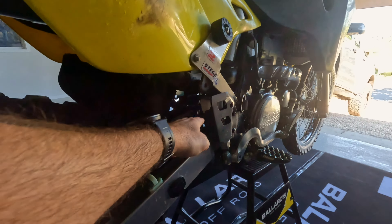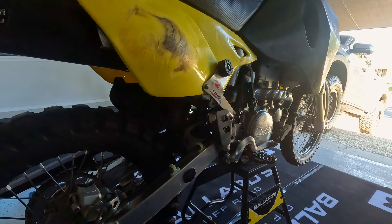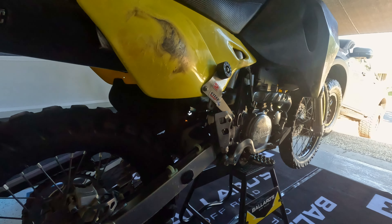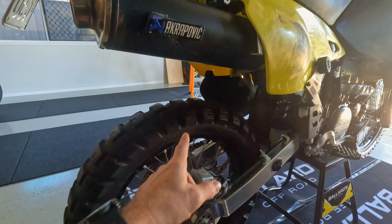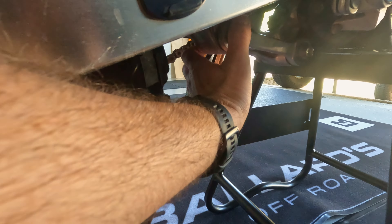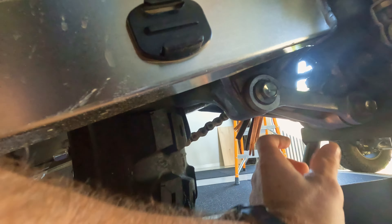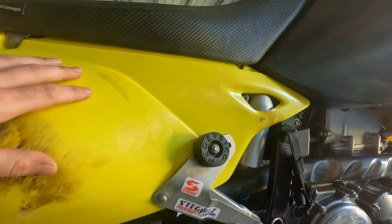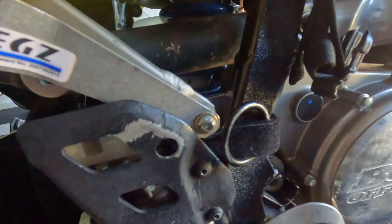This is me not knowing anything - I pulled the rear shock out while the bike was just sitting on its wheels. As soon as I pulled the shock out, the back of the bike just squatted down and the bike fell over. So don't do that. For the rear shock, you're going to want to take off your rear tire firstly - that'll be job number one. Then you're going to want to lift your swing arm up at the back and hold that up while you undo some of these linkage bolts to get to your rear shock at the bottom. Once you move all that and get that out of the way and unhooked from the shock, you've got access. Then it's just as simple as removing the plastics so you can get access to the side of the shock - there's a bolt at the top holding it. Once you undo that, it'll just drop out the bottom.